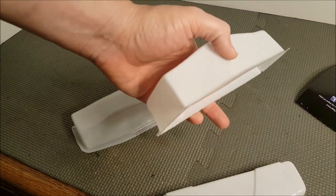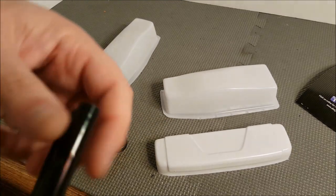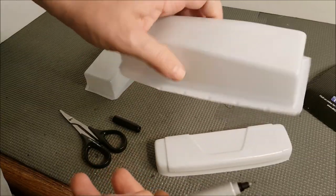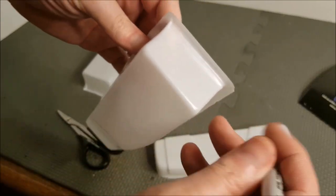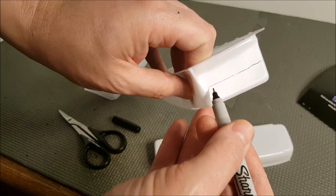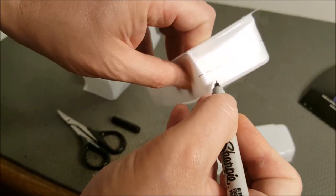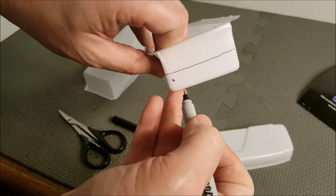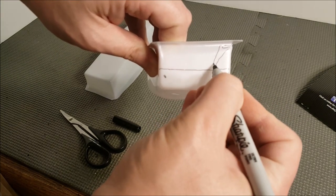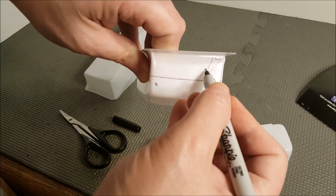The first step is to trim these out. To cut them I have my Lexan scissors and a Sharpie. I'm going to draw the cut lines in because even though the score lines are there, they're really faint, and I'm going to modify them a little. Up the front it kind of curves in to go around the roll cage, but I'm going to bring it straight up because I think I can use that mounting point where the cage mounts the cab to help secure the bedside. Down here I want to modify it so it comes in so I can use another screw through the cab and the bedside to help hold it in place.